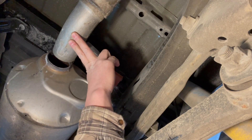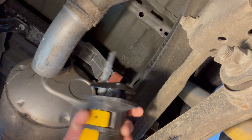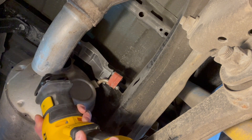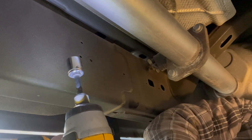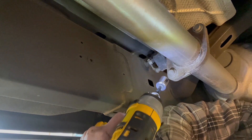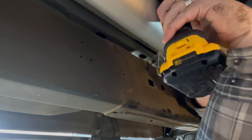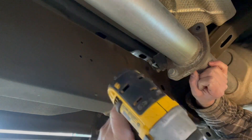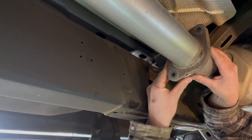I just cut this off — I thought I was filming it but I wasn't. With this DeWalt saw you can turn the blade sideways so you can fit in there way easier, which is what I ended up doing. Now let's get those bolts off. The instructions said 15mm, but the bolts on the truck are actually 16mm, so just so you know — use a 16mm socket.